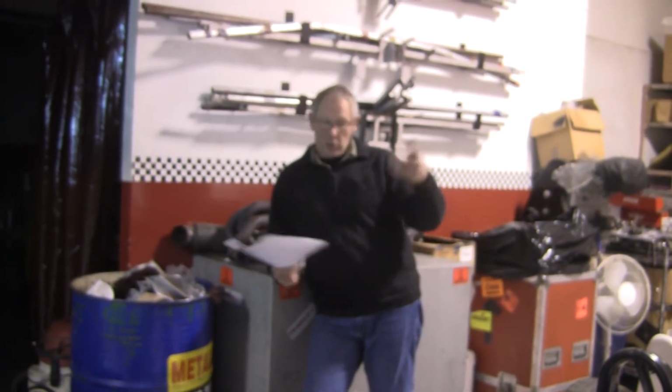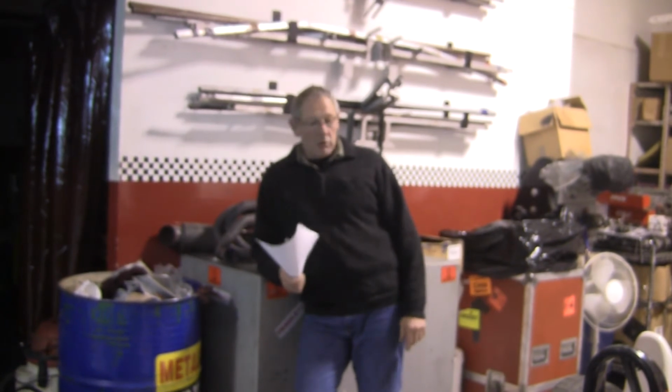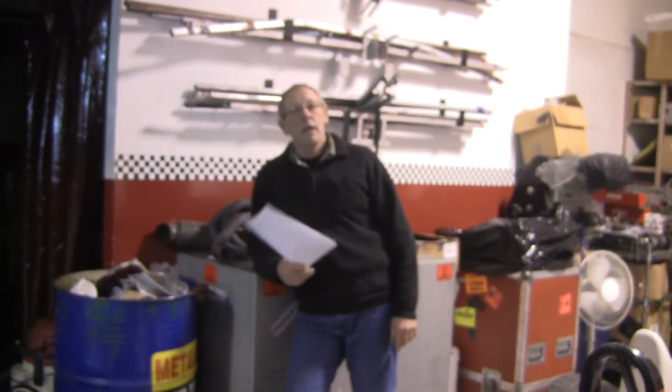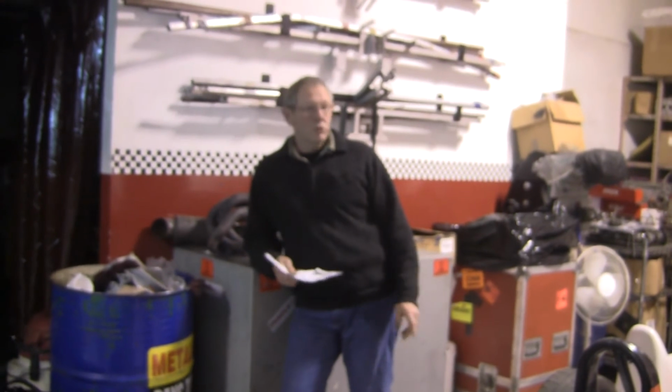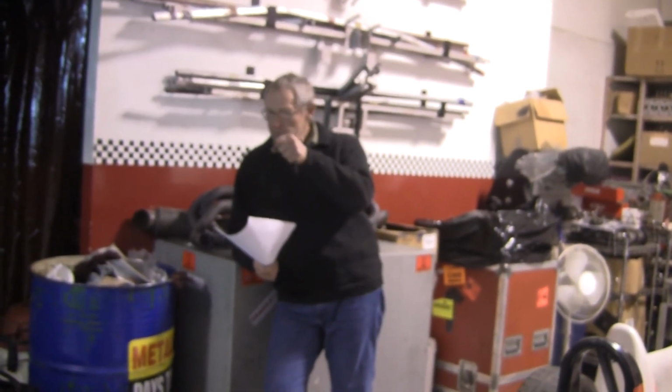And you'll put the scales on and you'll take the anti-roll bars off, and you'll sit it there, and if there's a kilo in it, I'll eat my hat. I mean, we always do check it, but hardly ever change it. A quarter of a turn on a push rod sometimes.